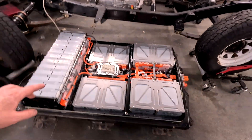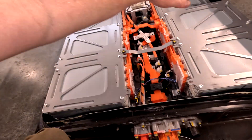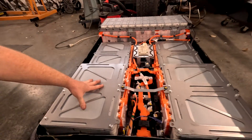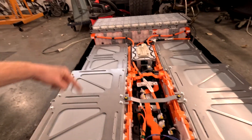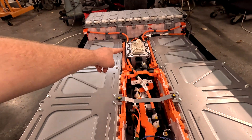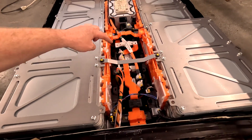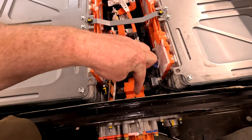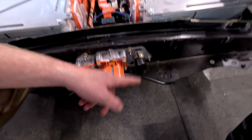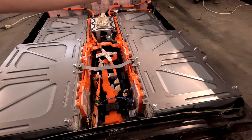We also got the Nissan Leaf battery open. You can see the cells inside — there are cells on either side and a long stack in the back. This is the 40 kilowatt-hour version, a little different from other Nissan Leafs, with 24 modules total. Some earlier Leafs had 48 modules. There are 12 modules in the back and six on each side. You can see the service disconnect, a fuse underneath, a current sensor in the middle, and the high voltage contactors — two contactors and the pre-charge relay. There's a wire takeoff for the heater, main bus bars that bring high voltage out to the plug, and a separate plug for the BMS. The BMS is actually in the far back corner, mounted vertically on the side of the cells, and we're going to wire it to the Resolve EV.